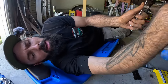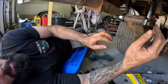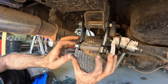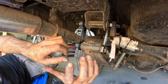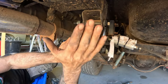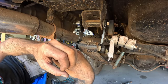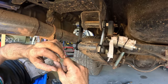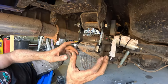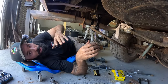Important tip — whenever you do suspension components, especially when there's rubber involved: when you've got a pin that goes through rubber, the rubber doesn't actually spin in there, it just flexes. At the moment it's jacked to full height of the suspension. If you do the nuts up tight now and then let all the weight off, they're going to be preloaded all the way around the rubber, and that's a quick way to shear rubber off and wreck your shackles. That's probably why shackles wear out after only a couple of thousand k's. So lower it back — leave them just loose — lower it back to ride height and then do them up as your final tighten. That's your median height, and that's a really good tip.